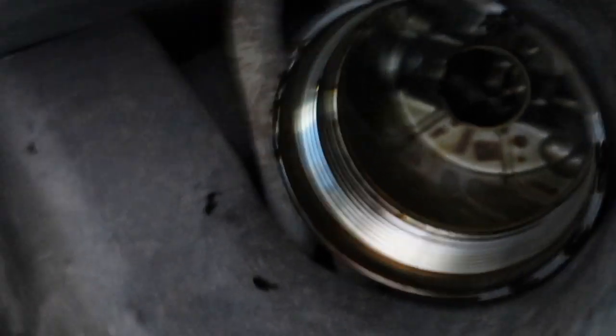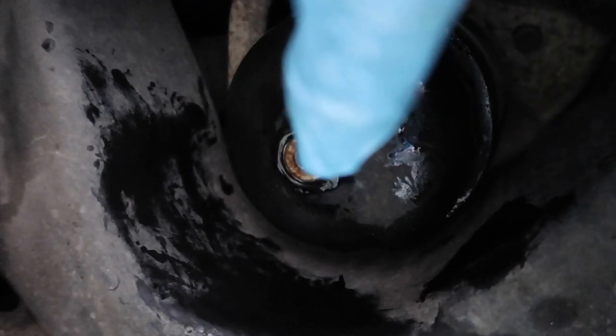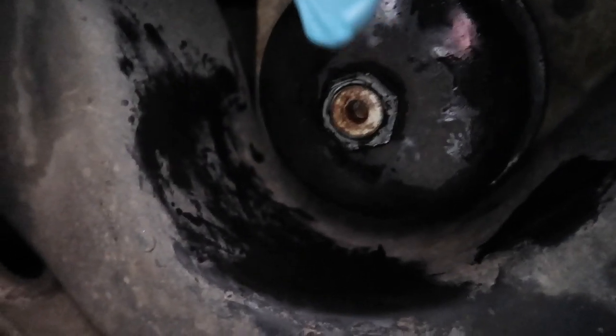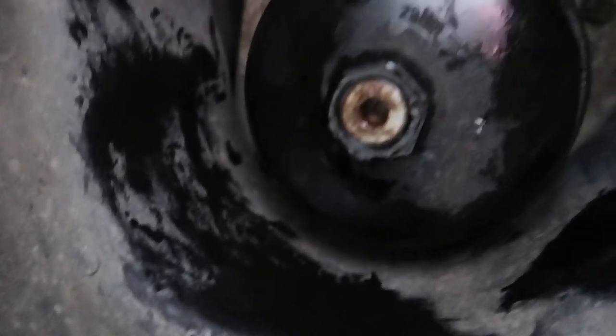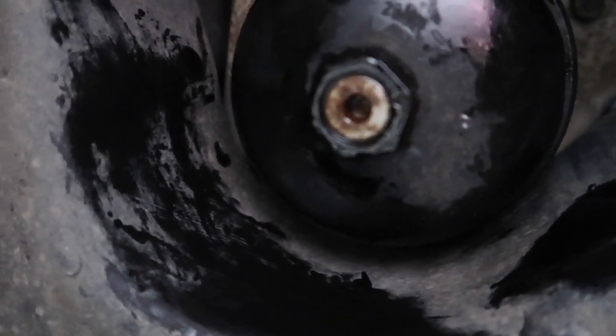Now we're going to reinstall the oil filter. We've got a brand new Mann filter to go in and we're just going to screw it up. That's all done — fully seated in with the oil filter. Now we're going to screw the housing back on. It's all fitted, everything's perfect and that's back on. Now we're going to lower the car and top the engine up. It's very easy: remove the drain plug first, then the oil filter with your 24mm socket and the 6mm allen key bolt for the sump plug and oil filter drain plug. That's the oil filter change done on the S85 engine — now we just top it up with oil and start it up.